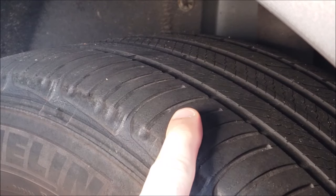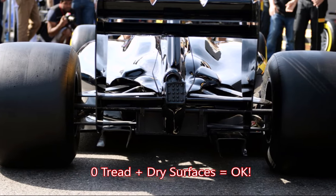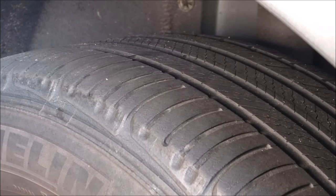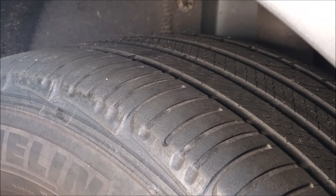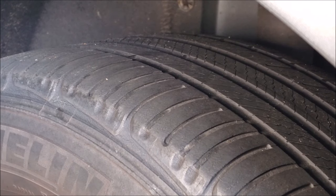If you are driving on a dry surface, you could have a completely bald tire. Just like Formula One or drag cars, you can have excellent traction with very bald tires in dry driving conditions. The tread is mostly for gripping during various weather conditions, such as rain, snow, anything like that. Because water is non-compressible — it can't just be squished, it needs to be pushed and moved out of the way. Your tires have these treads going down the main lines to divert water away so that your tire can maintain its contact with the ground. Obviously, the lower the treads get, the less water management there is and you risk hydroplaning, which is basically water skiing — your tire can't make contact with the ground and it's riding on top of a puddle of water.